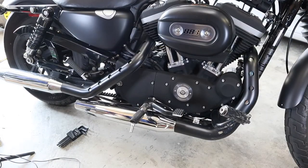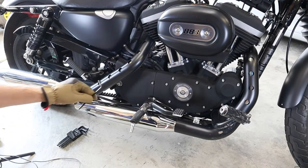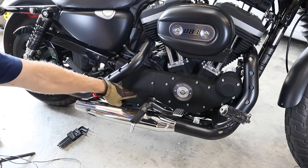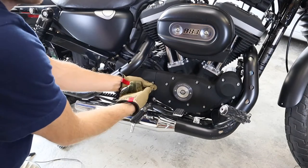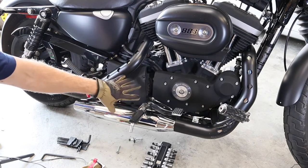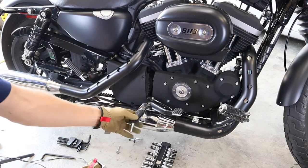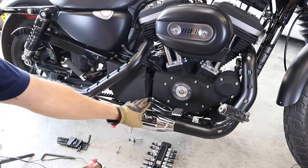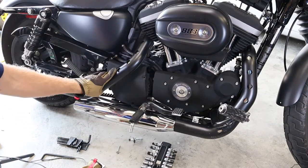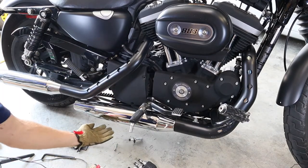Back in the garage with the bike cooled down. I'm going to start with taking this cover off — that's a 3/16 allen. I'm going to try to remove as little as I can to get access. I struggled with the cover for a while and I can't get it to clear the exhaust and this pedal on the bottom exhaust, so I'm going to start with taking this bottom exhaust off, which will give me access to the rear brake.